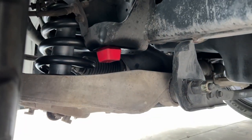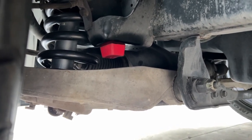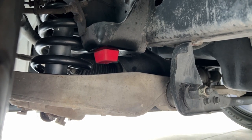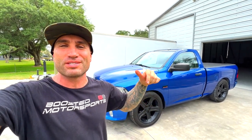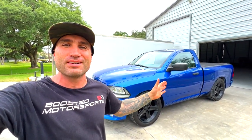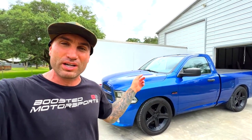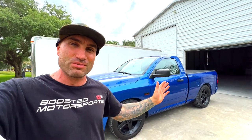You can see the bump stops and the clearance between the two. If you left the original cup in with the stock bump stop you'd literally be sitting on the rubber bump stop, making your ride all bouncy. That's going to be a wrap for this video - super happy with how it all turned out. I'll link the products we used in the description below. I'll keep you guys updated as we get the relocation brackets installed and swap out the shocks. If you're new to the channel, hit subscribe and give this a thumbs up. We are also hellcat-swapping this truck - we already have a hellcat-swapped Dakota, so lots of videos coming.